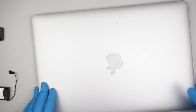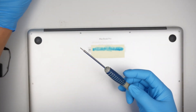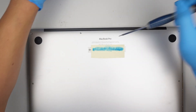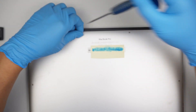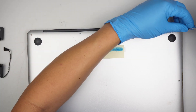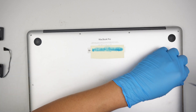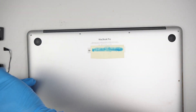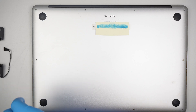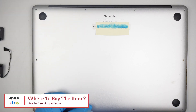Let's go ahead and get started. First I need to use the Pentalobe P5 to remove all the screws and remove the back cover. If your speaker is giving you a static sound, buzzing sound, or crackling sound, more likely the speaker has blown and the replacement speaker would definitely fix the problem. If you're not sure where to buy the replacement speaker, please check the link in the description below — I'll link it to either Amazon or eBay.